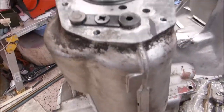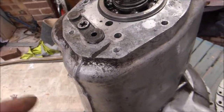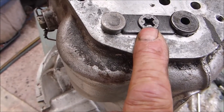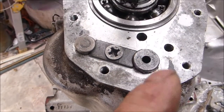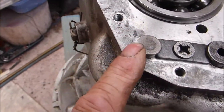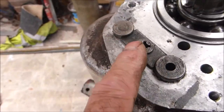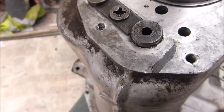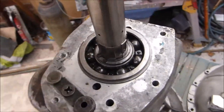This is the old one which I'm going to scrap. There is a crack in the bottom — that's the reason I took it out. The first stage is to undo this here; I'll probably need an impact on it. Then I'll have to take out this lay shaft and drive it right through. This other one here is for the reverse mechanism, and that is the last thing to come out, as you'll see.